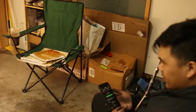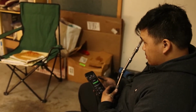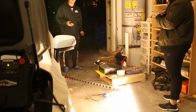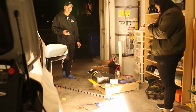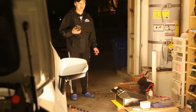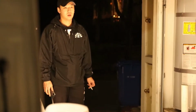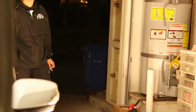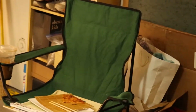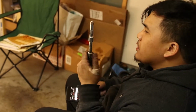See if he can still return some of the stuff. You should. I mean, we didn't open it. Dump it in there. That's the fastest way to find out. How I found out was, I heard the knocking, I drained the oil, and I had a magnet plug. As soon as I opened up my magnet plug, I saw metal shavings, and that's usually copper from the bearings. Yep. But 25,000, dude?